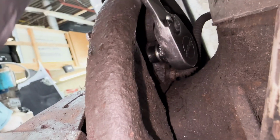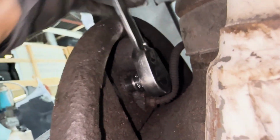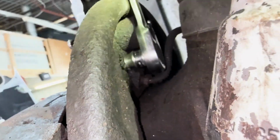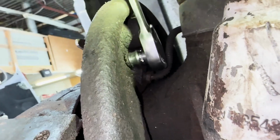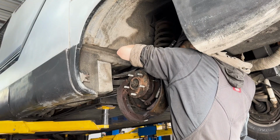Now for the bolts holding the brake cylinder. I used a 10mm here, and it worked for the first one, although you can tell it's not really right because the socket was on there pretty loose. The other side I had no luck with though, unfortunately. It was tight. The 10 was starting to round the bolt off and 9mm was too small to fit over.